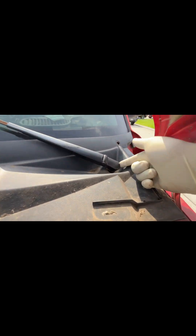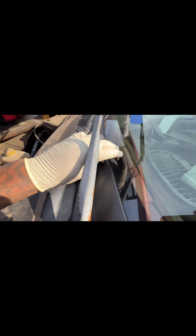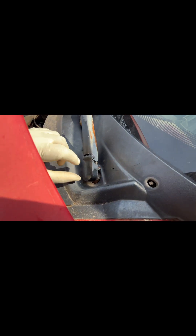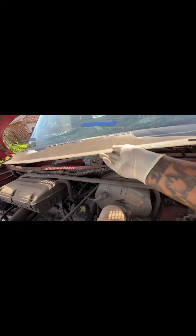Pop these little covers up. The trick to get this wiper blade up and off: you see this little tab right here — pull the wiper blade up vertically as if you're turning out the blade itself, pull it straight up. Grab a pair of pliers or something similar to pull this piece towards the windshield. Once you do that it locks. There's a little piece in this channel keeping the blade up. Hold it there, wiggle it, and pull it straight up. Now both windshield wiper arms are off and all the clips up top are off — this is technically free.